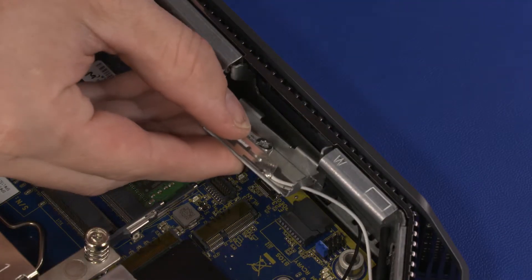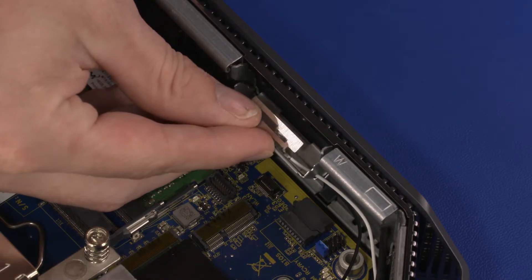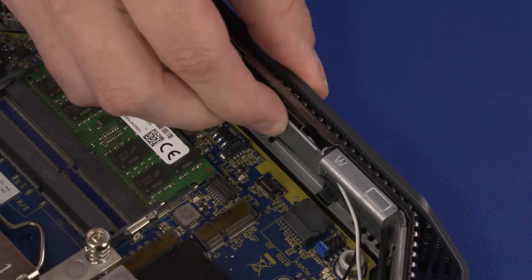Toe the tabs on the lower edge of the main wireless LAN transceiver into the chassis and apply pressure to the top edge of the transceiver to secure it under the retention clips.